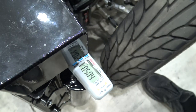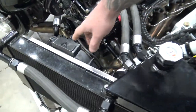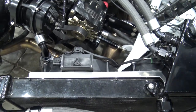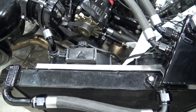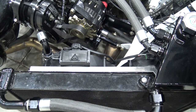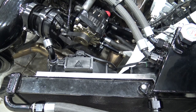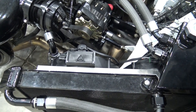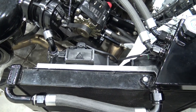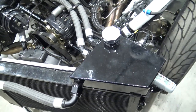What it was doing was finding home. Since these are brushless fans with a controller built in, it finds home — it sees how fast the fan is already spinning and matches that RPM before it actually starts up. When it's stopped it knows the fan isn't spinning. It's also checking for any resistance on the fan blade or motor, like if a finger was in there. It was a very slow roll up to right around 12 amps for one fan.